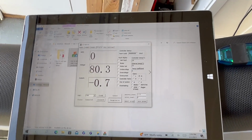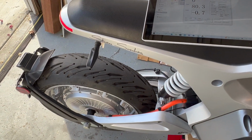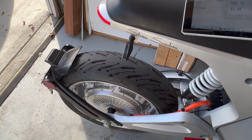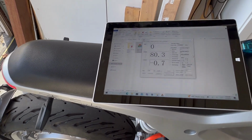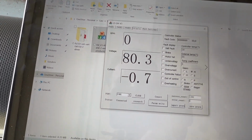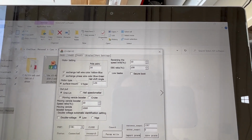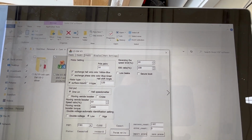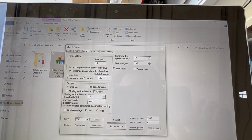I'm going to show you also how the bike behaves, and it's quite rough. So let's see. You see, it's almost instantaneous and it goes back. So bottom line is you can adjust this parameter as you please. Anything between 0, which is no EBS, to 100, and you're going to change the amount of regenerative braking.